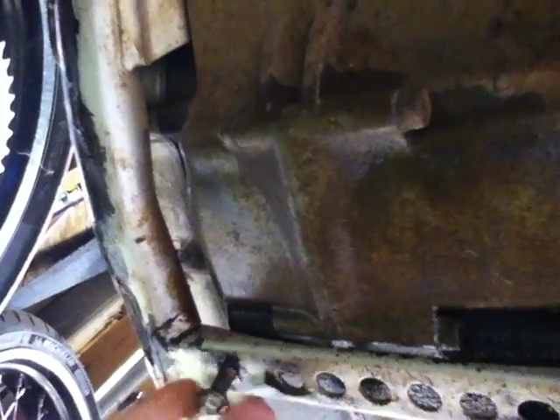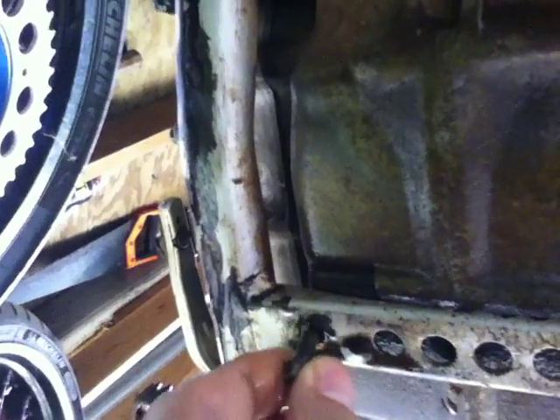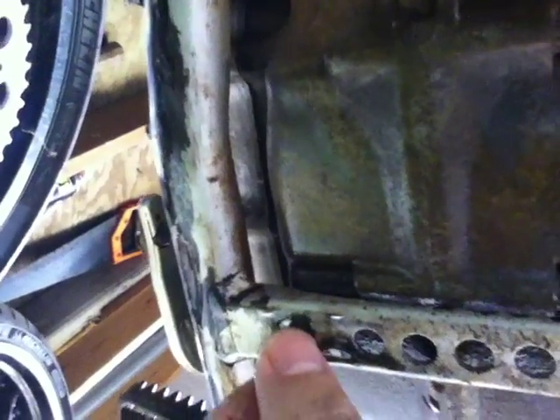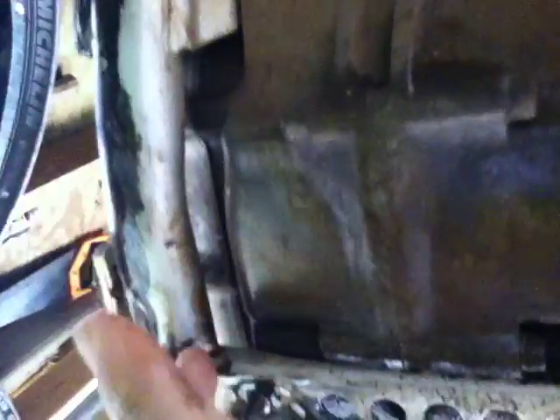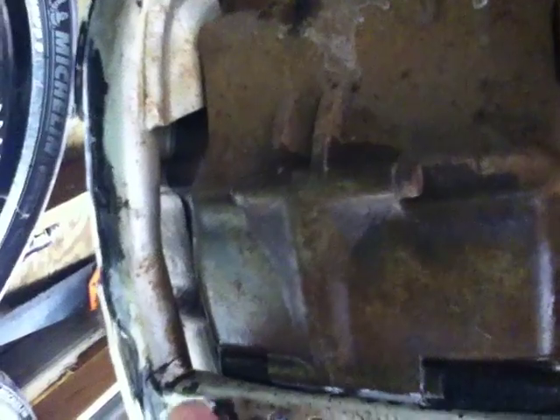It was both an error by Evotec and Yamaha. The hole is right there — this is the original Yamaha bracket to hold the skid plate on, and this is an Evotec bolt right here. This thing is way too long. After it goes through and holds the skid plate on, the end of the bolt is pushing on the crankcase. Without any external support on the down tubes, the plate on impact is not doing nothing — it's been pounding on my crankcase.